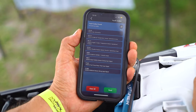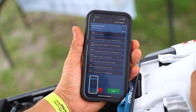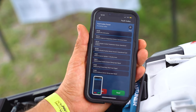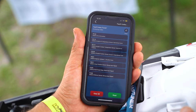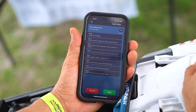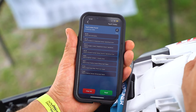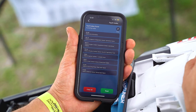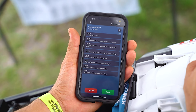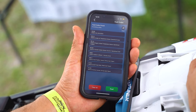At this point I'd like to take a screenshot so that way it saves to my photos and I can go back and review what was going on. Now I'm going to go through the bike and check for obvious reasons why it would be throwing codes like this — loose connectors, broken connectors, broken wires, loose battery bolts. Then we're going to clear the codes and read them again to see if we have existing codes after we check everything.